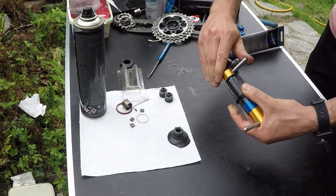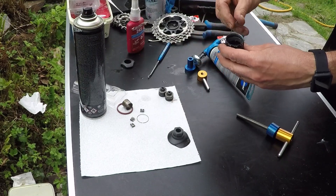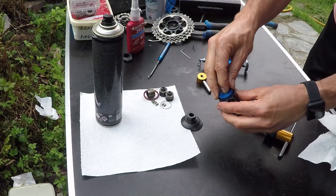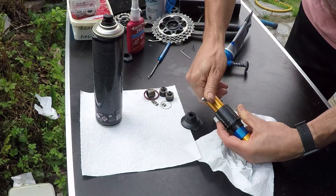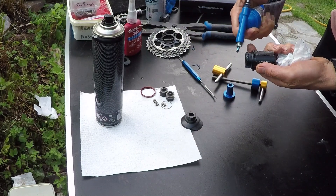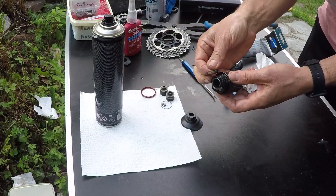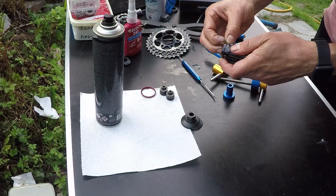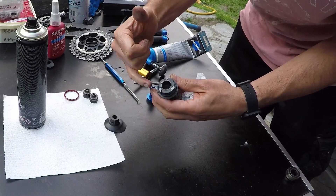Press the inside bearing past the outside bearing's position and then reverse the RRP blue driver to push it into its final position. Replace the grub screw with some thread lock. Grease the hub spacer and reinsert. Then grease the outside 6902 bearing and press it in using the RRP tool. Insert the greased hub spacer and then lightly grease the pivot to the pawls — the grease will hold them in position while you replace the clip. Make sure the pawls return to their engaged position. Finally, insert the rubber seal back over the outside free hub bearing.